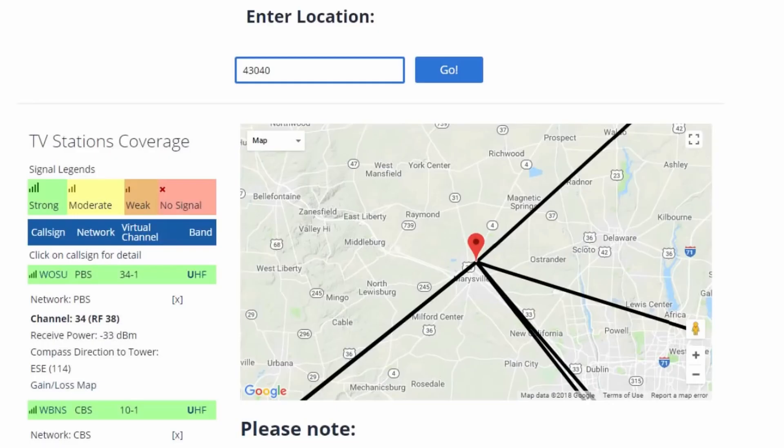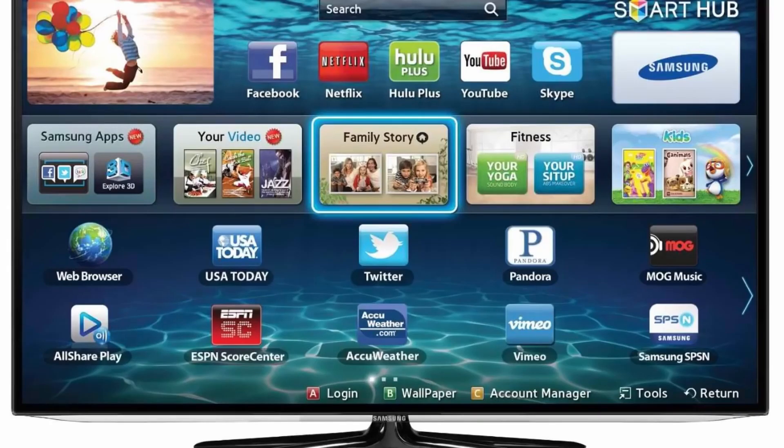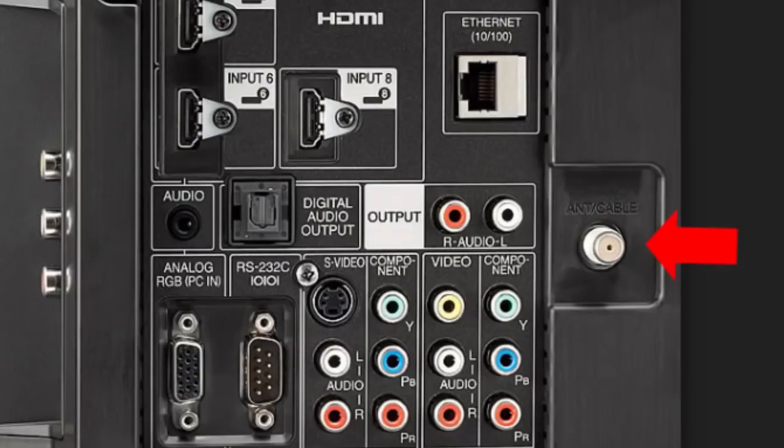The first thing to do is ascertain your over-the-air availability. If your TV is still an old analog TV purchased before 2007, then you will need a converter box to receive digital broadcasts. Many converter boxes are also available with DVR built-in so you may record programs. There is a link in the description for converter boxes. If you have purchased a TV since 2007, it is probably a digital TV. You will need an antenna and a piece of coax cable to connect the antenna to the TV. On the back of the TV or the back of the converter box there will be a coax connector that looks like this. If there are two, use the one marked ANT or antenna.